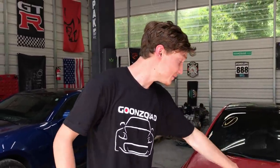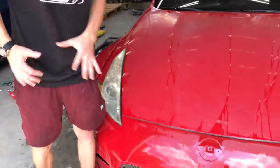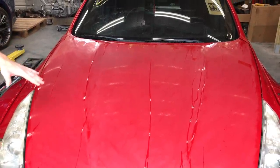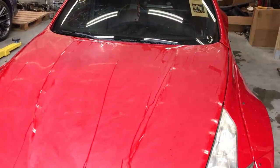So we just finished sanding the hood and the front part of the bumper — actually the top part of the bumper — with the 2000 grit. We're not going to go into all the steps because the paint job has actually turned out pretty good, and it cut down with that 2000 really smooth. Now what we're going to do is actually go ahead and sand this with the 3000 grit, and then once we're done with that, we're going to move on to the back and get that deck lid. After that, I think we're going to pull out our buffer. That's all we've got to buff here — everything else is looking great. I do want to try one thing though, I almost forgot.